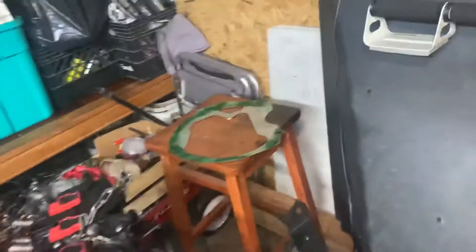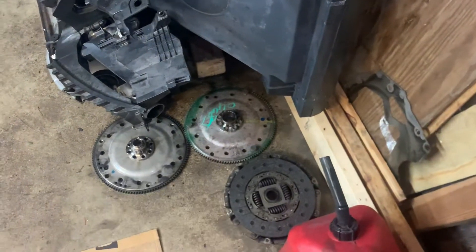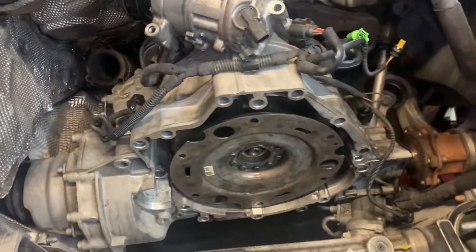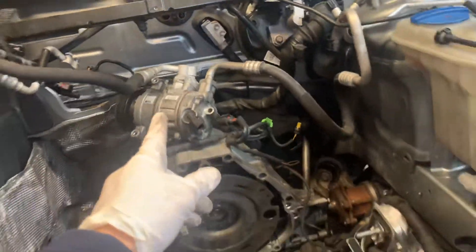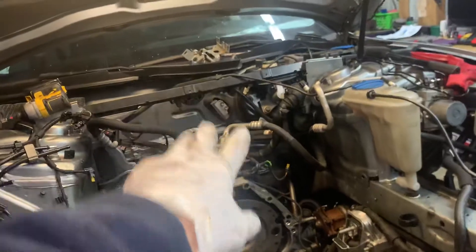We still have a few things to do before I drop it in. I gotta put that plate on — I'll probably go with the green one. That's the old clutch; the new clutch is installed, everything there is good to go. Motor mounts are in, and that's where the engine is going to sit up against those two motor mounts. Got the AC compressor I'll be bringing down along this side, power steering pump, and running all my hoses through the back.